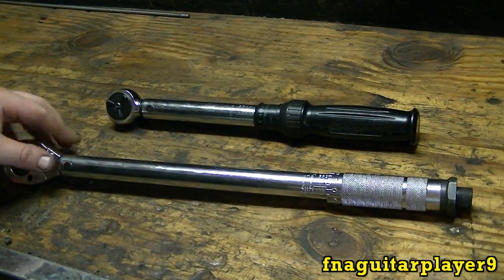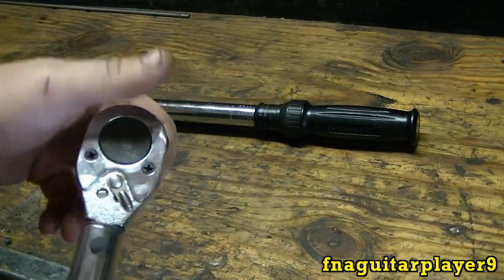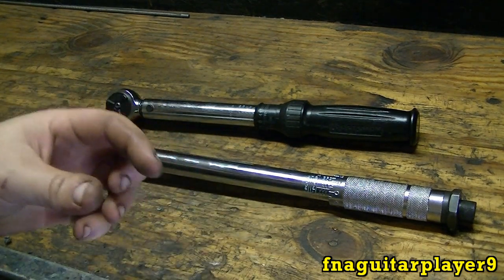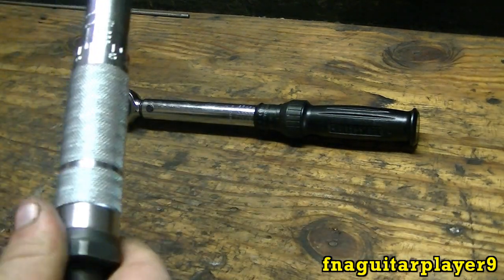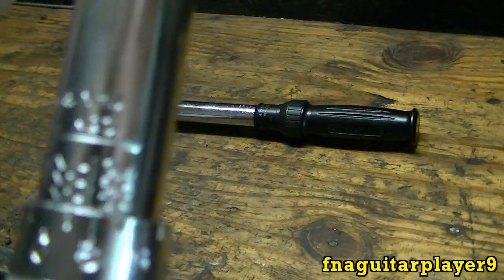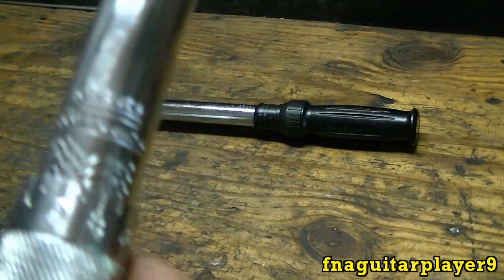As you notice right off the bat, the half-inch drive is quite a bit bigger. This is a half-inch drive for half-inch sockets, and you've got forward and reverse on it too. This one is hardly ever used because for small engine work you don't really need it — except to torque a flywheel. Most people don't torque the flywheel because it's so hard to hold, but I've been doing it lately because I actually stripped out a nut without using an impact. This one measures in foot-pounds. There's a lock on the bottom.